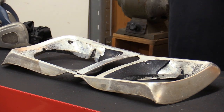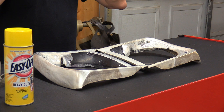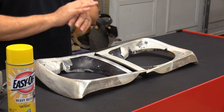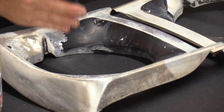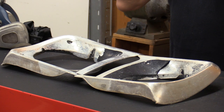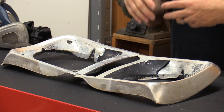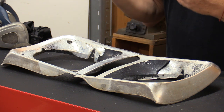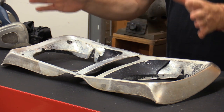This is by far the most fun way to do it. I put it on here and I walk away for an hour. I come back, the anodizing is pulled off, and I can go about my business of cleaning and polishing everything. If you go in and do a mechanical removal method like sanding or glass bead blasting, you're going to be at that for at least an hour, maybe more, trying to get it out of some of these smaller crevices around the headlight doors. I've done both methods — Easy Off is the easiest way to do this. The cons are that you have to basically insulate yourself from the product so you don't ingest it or get it in your eyes. But as far as a way to clean the aluminum down, in my opinion, it's the only way to go.